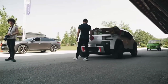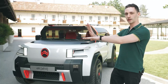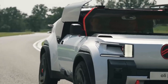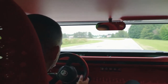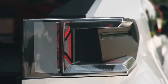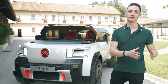Let's talk about the windshield of Olli. The logic behind this was to first reduce the mass of the car. We took a classical windshield, put it upright, and cut it in half. So basically we reduce the cost of it, the weight of it, and you still keep a very nice vision from the inside to the outside of the car. It's not very aerodynamic, but the car is not meant to go on the highway — you can go up to 110 km per hour with it. We thought about a little air duct to help mitigate the aerodynamics, but the point is that it's better to be light than to be fast.